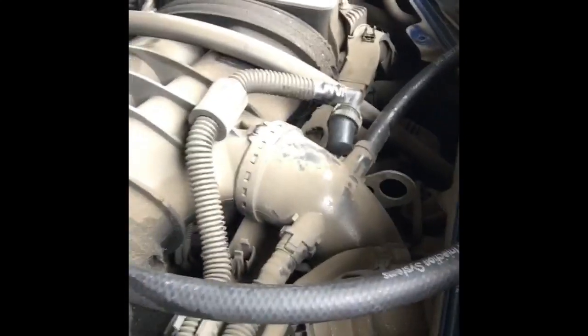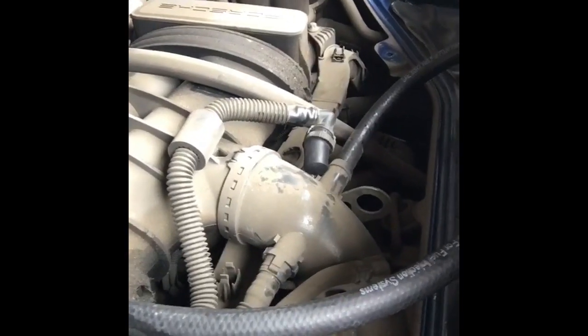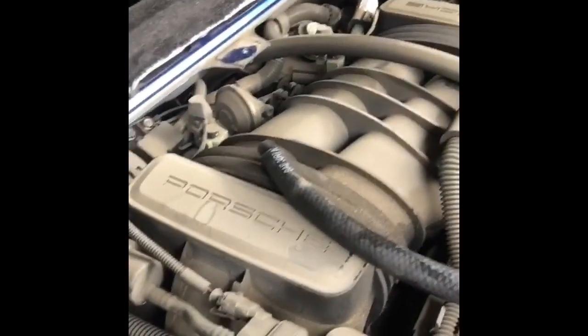It's pretty straightforward. We got a hose runner into the intake, past the mass airflow sensor. It goes into the little accordion style sandwich intake manifold. I've got the oil return line plugged, and I've also got the main line plugged. This bypass line that I have plugged, I'm going to put the seafoam in through here.